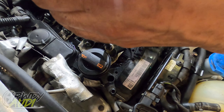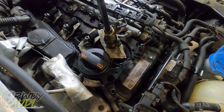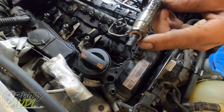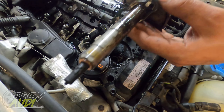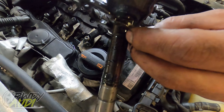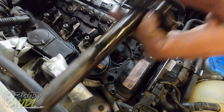So to do this, screw that end on there. And there we go — that's pretty freaking good. We got our copper o-ring. Now you want to make sure when you pull these injectors out that you get your o-ring off the bottom of them, and take notice of which direction this little guy comes off. It sits in this notch right here but it's wavy on one side. Let's set this down and get the rest of them out.